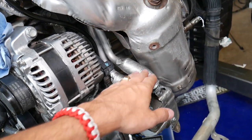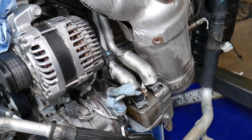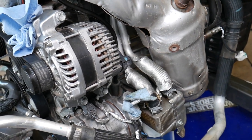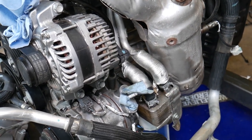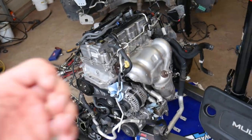Here you have two hoses that go to the oil cooler — make sure they're installed correctly, not cracked or melted from heat, because sometimes they crack especially if someone didn't install them correctly. Those are the potential places where you can develop a leak, and of course the radiator itself or the radiator drain plug. Thank you for watching — please subscribe to the channel for more videos, and see you next time.